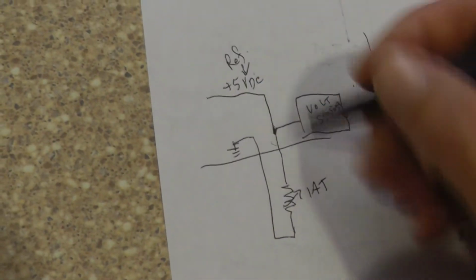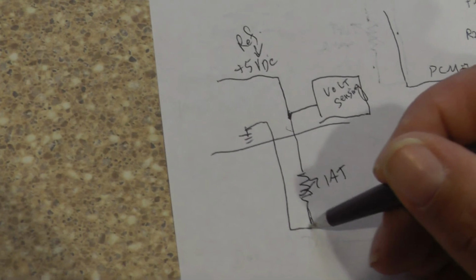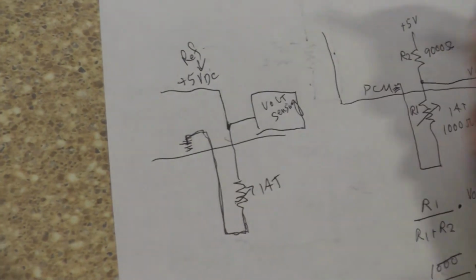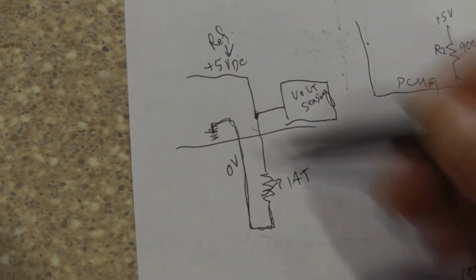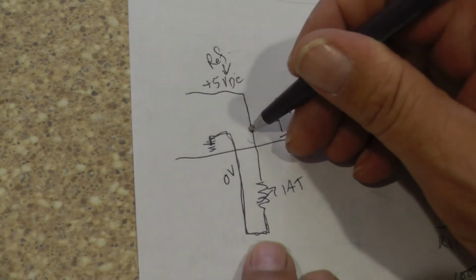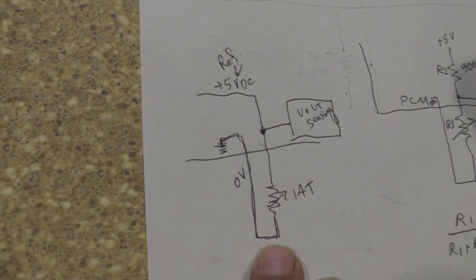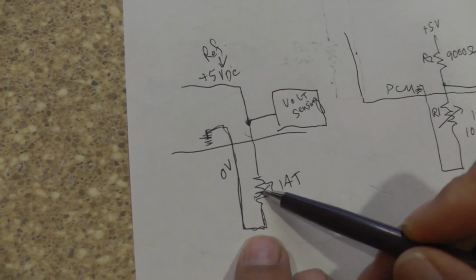Another comment seemed like, as the current is coming through, over here we had a low reference signal wire, right? And then, no, this is 0 volts. That's ground. That doesn't change. That voltage stays the same all the time. So keep in mind that this circuit, like it is, will not work. It will always stay 5 volts, even when the resistance side here changes.